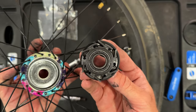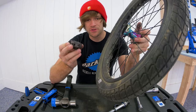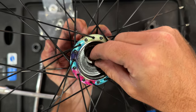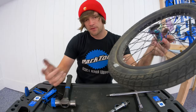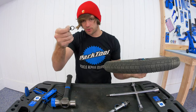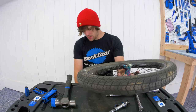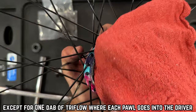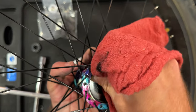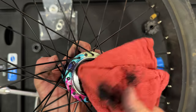We're going to be refreshing the driver as well, but we'll start with the bearings. Before you do any of this, make sure you keep all of the components. If you lose any of the pawls or springs, or with a Profile hub this washer that goes between your driver and the bearing, you're going to have problems. If you lose this spacer here, you're going to have hub wobble — it needs to be there. I like to put it aside in an orientation I'll remember. Profile hubs are actually not supposed to have any kind of lubrication or grease in them.